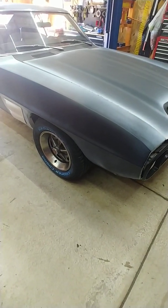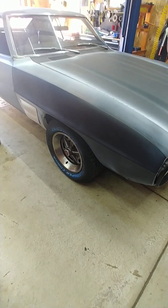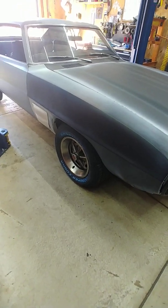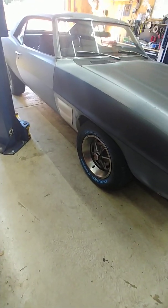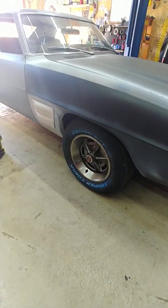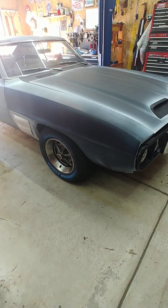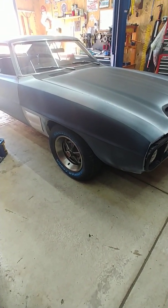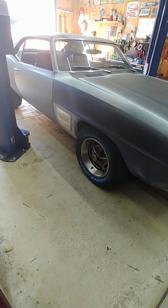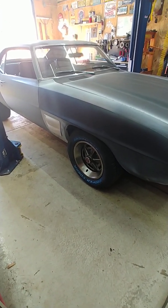1969 Firebird tire sizes. There's a lot of stuff online that you can look up. It tells you what tires fit first gen stuff for the Camaros and the Firebirds. I can tell you unequivocally, if you have 15x7 Rally 2s on the front of a 69 Firebird that has good springs, stock suspension, and it sits up where it's supposed to, 235 60/15s will work on the front.